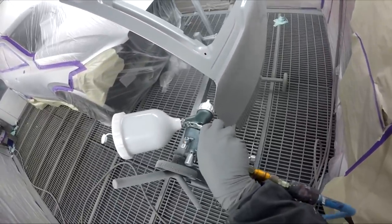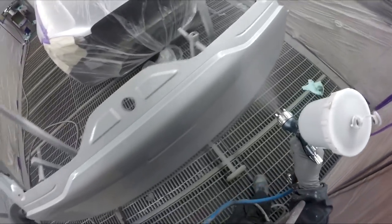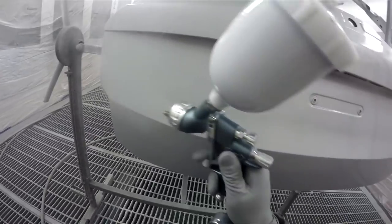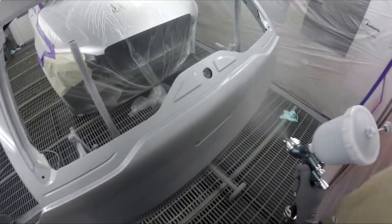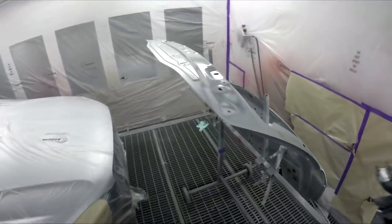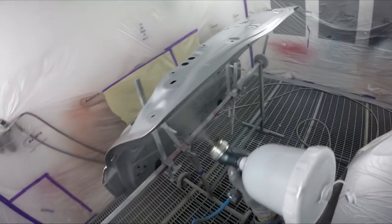It's just some bright silver - I think it was called something like that - it's a Volvo color, 711 with the paint code. It's winter now but even in winter this stuff can still dry a little bit too quick for you depending on the spray. I'm using the Stando booth, and if you have the booth turned up too hot it can actually make a bit of a mess even on single panels like this tailgate. So I've turned the booth down to 24 when applying my base coat.